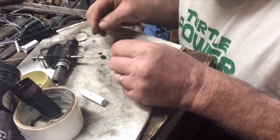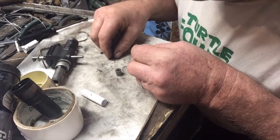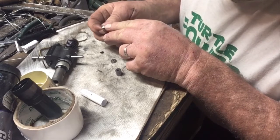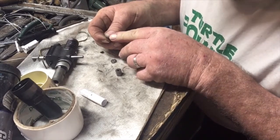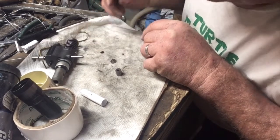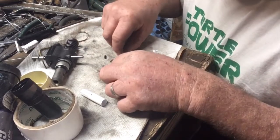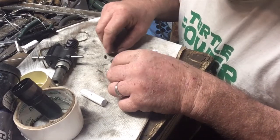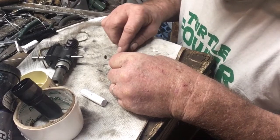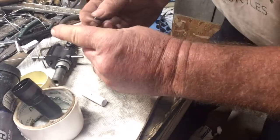And this is the valve or check valve. I know you can't see any of this, but you can see around the edges where it would go against that hole with the spring. And this piece has to go to the upside, because if it went to the downside, it would just plug that hole off. So I'm sure those slots let the fuel by. So I had this in there yesterday too. I just dropped it in.